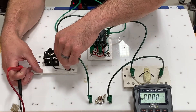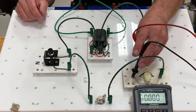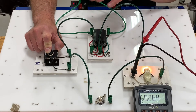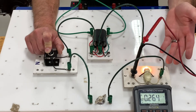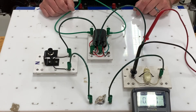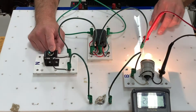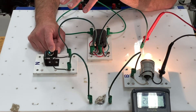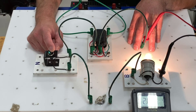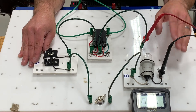Let's compare that to the light bulb. Repeating the same in-series measurement on the action side, we've got just over 0.2 amps with this small 194 bulb — a little bit higher than my control side, but that's largely because this bulb is so small, so there's not a lot of amperage change and it doesn't show the difference between the two sides very well. Let's unplug this and put in a larger bulb. With this larger bulb, we've got two amps worth of current. So we went from about 0.196 amps on the control side of the relay to about two amps on the action and load side — that's why we use a relay, to put that low control current on one side and use it to drive a higher current like the two amp light bulb on this side.